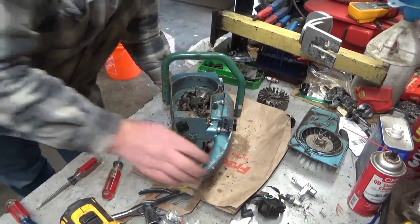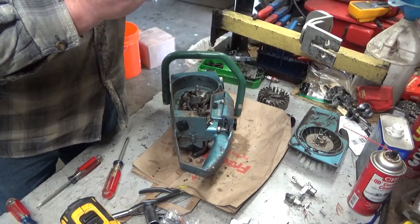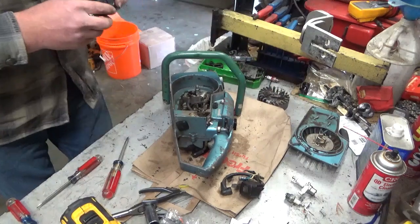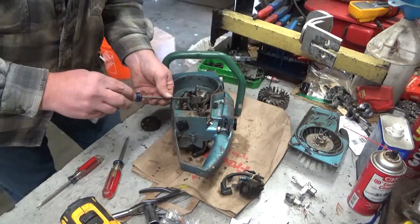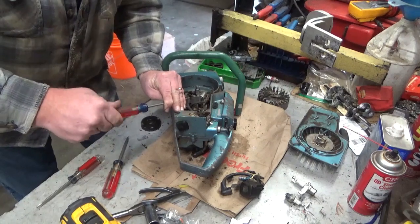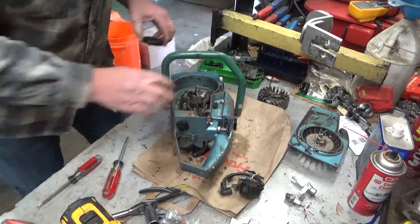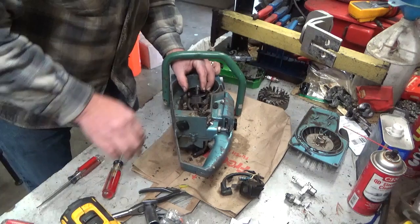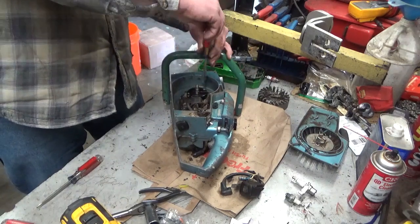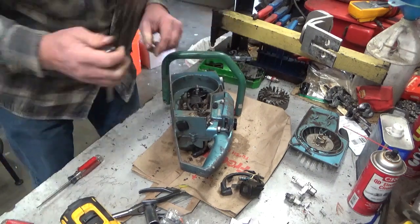That's a shame that that wiring is butchered, but again, it's soldered in place down here, and I'm not interested in screwing around with that. I'm interested in getting spark on this module, so we're going to abandon that in place. I'm going to tighten that screw back up so that it never rattles out. This is how a shop would have done it back in the day. They'd actually just cut that wire. They would never pull the flywheel. Because that's what's been done to this other coil here. Alright, so we'll abandon that in place.